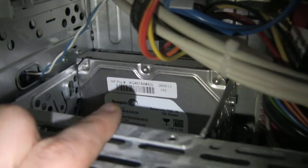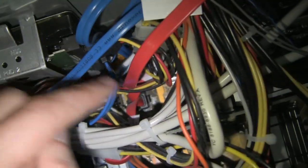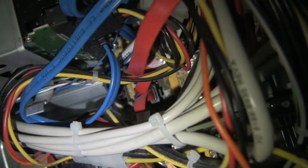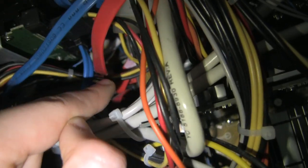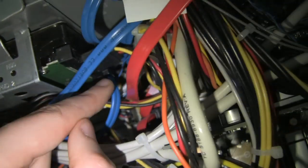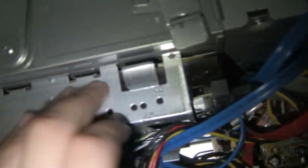So this is the original hard drive that came with it — it's a Seagate, 750GB. I added another hard drive up here and added the plugs. It was actually a pain to get it all the way down there. Down at the bottom there are things called SATA ports that sit on your motherboard. Basically you want to connect the SATA cable to the motherboard first, then slide the hard drive in, connect the SATA data cable and the power cable, and then it's good to go. But the way this one is, it's sitting in an enclosure blocked by the front case.